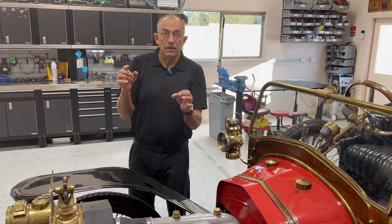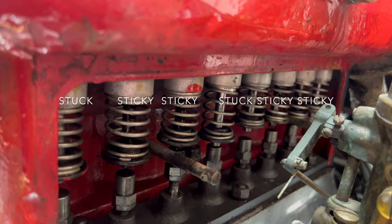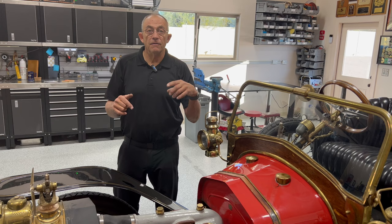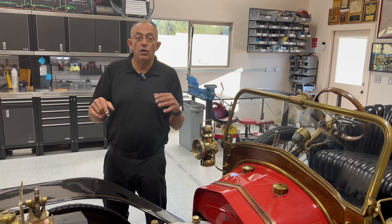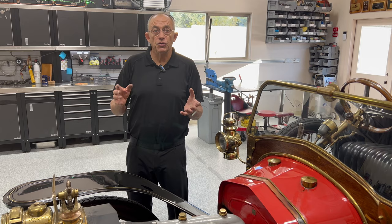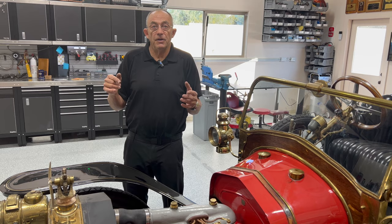With antique race cars generally there's low compression, inconsistent oiling, situations with huge amounts of splash going up hills or around corners. The chances for carbon buildup are high — you need lots of heat and compression and consistent long running to take carbon away. When I put this away it was running fine, but with carbon built up and oil coagulating on the surface, we have stuck valves. I'm going to take these valve ports out, and I can very gingerly tap on the top of each stuck valve to get it unstuck, or pop it from the bottom.